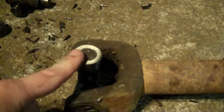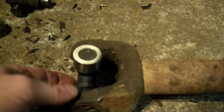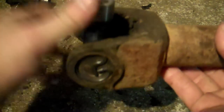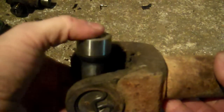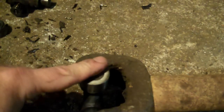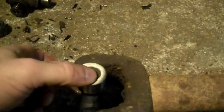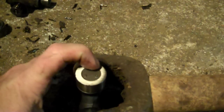The problem with loose drive shafts is these caps will fall off very easily. So if you have extra driveshafts in your Jeep, strap them down — you don't want them bouncing around, especially in an accident. A big steel tube will take your head off. To hold these caps on: get electrical tape, wrap several tight layers around all the caps. Electrical tape stretches really well and will hold them in place to keep them from coming off.